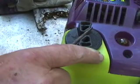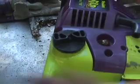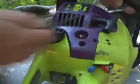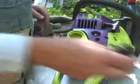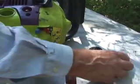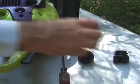One of the problems that we're running into with a little bit of ethanol in the gasoline now, it causes the caps, at least on this model chainsaw, to swell, and they're very difficult to get out, so we usually have to use a screwdriver to get them out. I have two caps, so I set one aside for a few days and it will shrink again and go back to the old size so that they fit in a little bit easier.